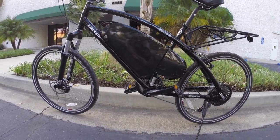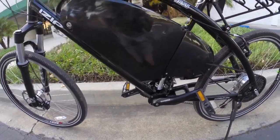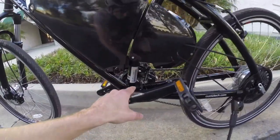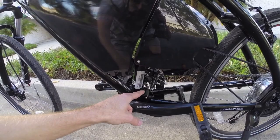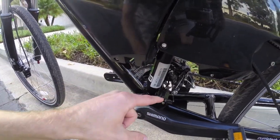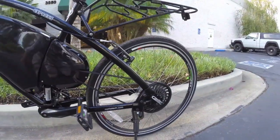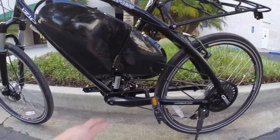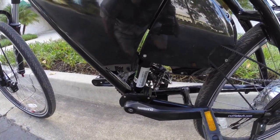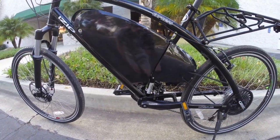I should mention that the way this senses your input — I've mentioned pedal assist several times — it doesn't use a cadence sensor, it doesn't use a torque sensor. It kind of uses this servo-activated speed sensor. So there's a little motor in here, and as you turn the cranks, it physically turns the servo, and that sends a signal back to the motor to give you power. And that's very unique — I've never seen that on other electric bikes. I think it's more precise, and it feels pretty responsive when you ride it.